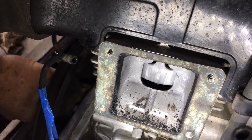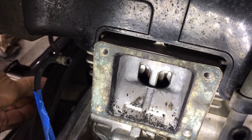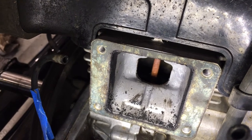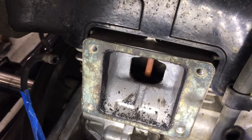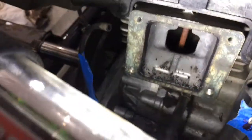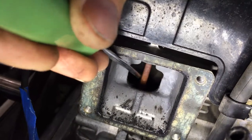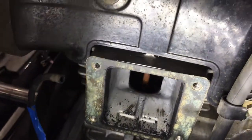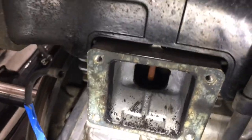You can hear that noise. The plug itself doesn't look damaged or scarred, but where we find that noise — I believe I can get my fingers in there. Basically, I've got side-to-side play in that connecting rod, though I can't get you a good picture of it.